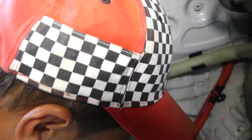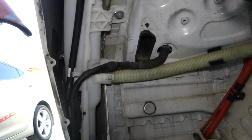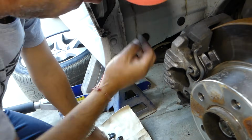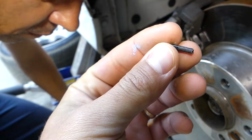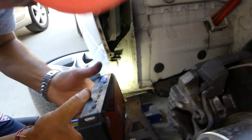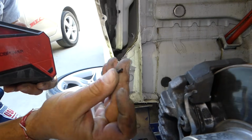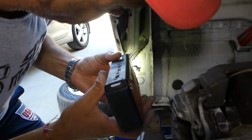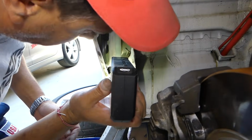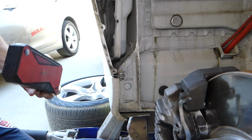Now this is where the windshield washer reservoir is. You can see right here. Now we need to start getting to it and removing it. We just found one of the plastic clip inserts. That's what it looks like. We need to find two more somewhere. One more. So we're just one short now. Hopefully we find this one. If not, we'll need to get some replacement clips. Again, everything will be listed in the description under the video.